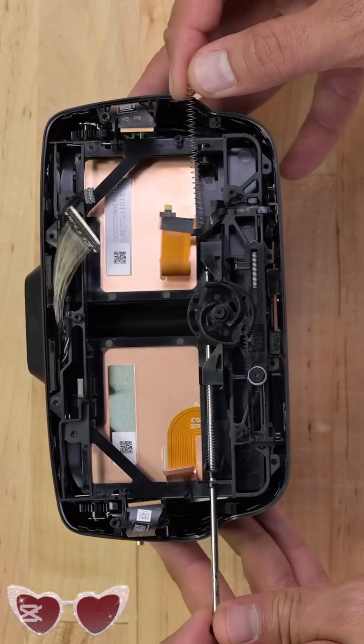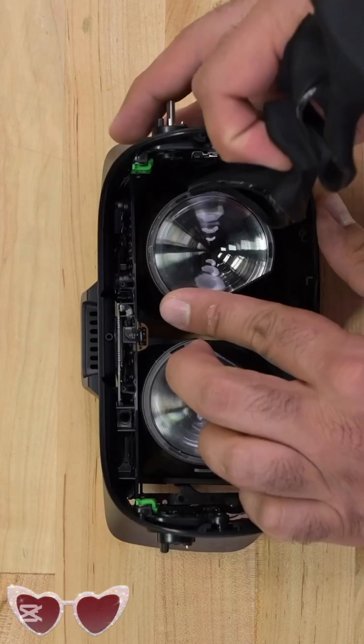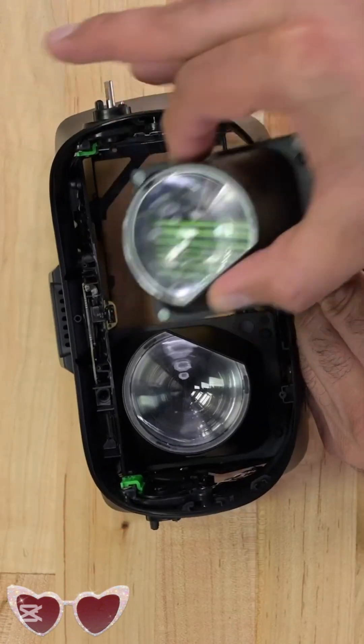Back to the front of the device to remove the upper and lower rails securing the display panels in place, and once those are out I can remove the plastic cover and rubber blackout around the lenses. It's now possible to gently nudge the lens assembly out and away from the mainboard.